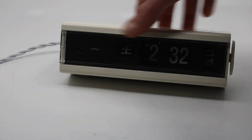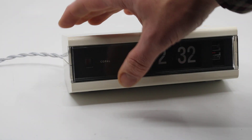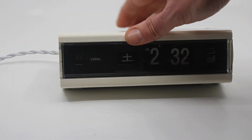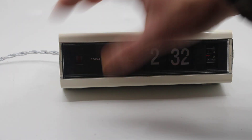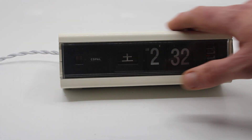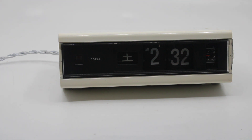The motor was fully reconditioned and lubricated. It got a new cable, a new plug; the wiring on the inside, the light, and the resistor were replaced. The case was cleaned on the inside, polished and brightened on the outside to a really bright white. It's in really, really good condition and will be for sale on either flipaclock.com or my Etsy shop called Flip Clock. That's it — if you have any questions let me know, thank you for watching.